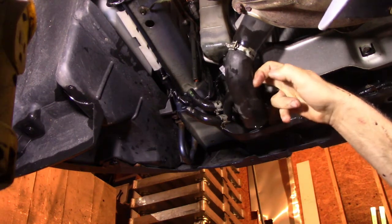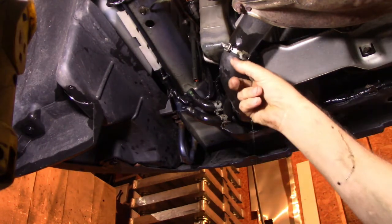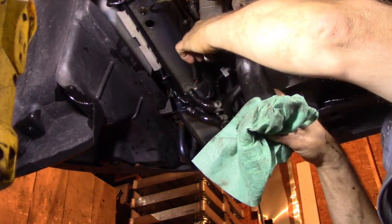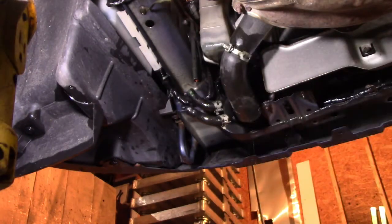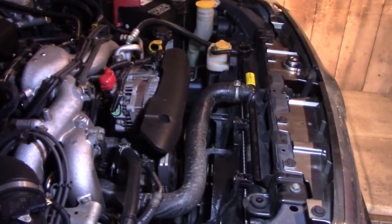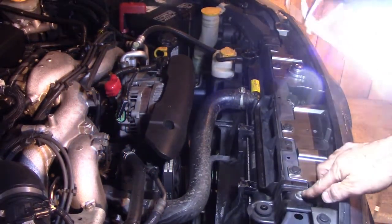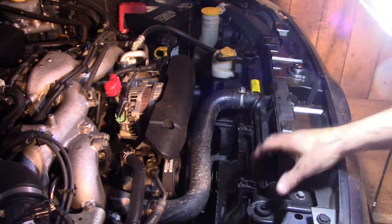Now what's left — just the top radiator hose. I'm expecting this thing to just pop right out. I did the electrical connectors — those came off decent. Let's go topside. I literally think I'm going to be done in ten minutes. Here's what I'm thinking: take this retainer nut here, looks like a 12mm, and this one, and this whole thing should just slide right out of there.